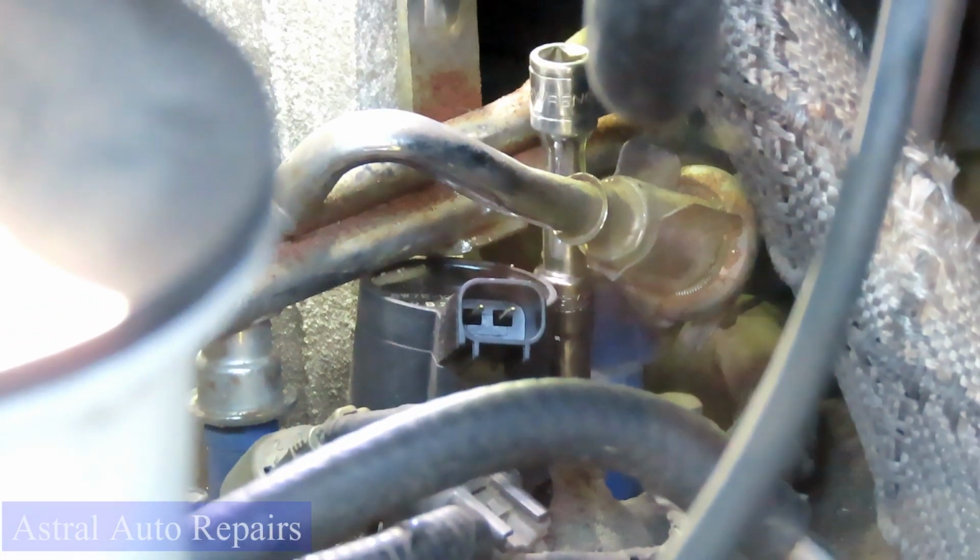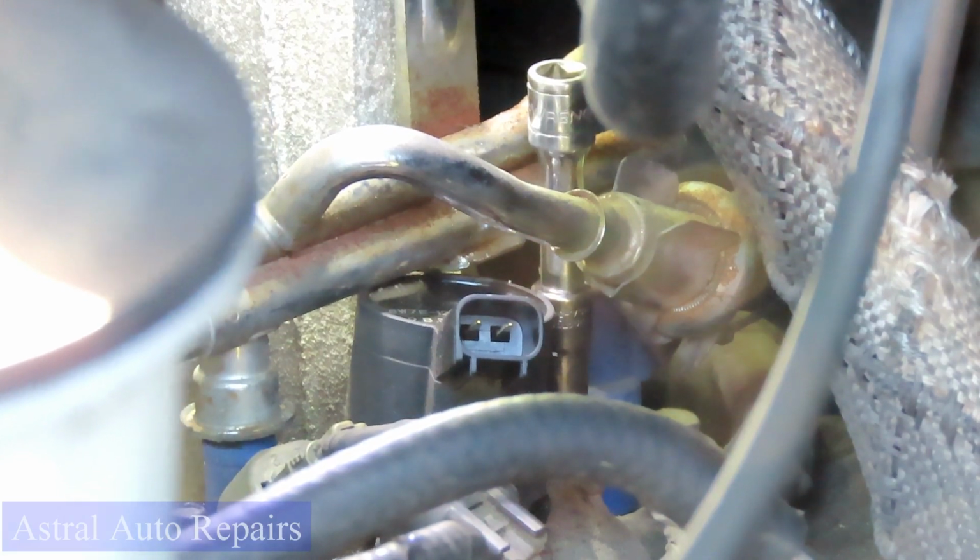And what we're going to do is now start tightening up all the coils. Now for that, because these bolts are so small, you do not want to use your cordless ratchet. What you want to do is use that setup along with your 1/4" drive ratchet. You want to tighten down. There's not a lot of pressure on these, so you ain't got to go crazy with it. You want to go down till it stops.